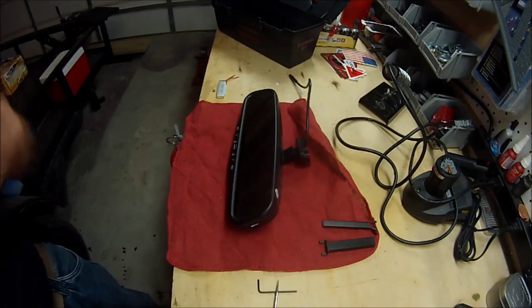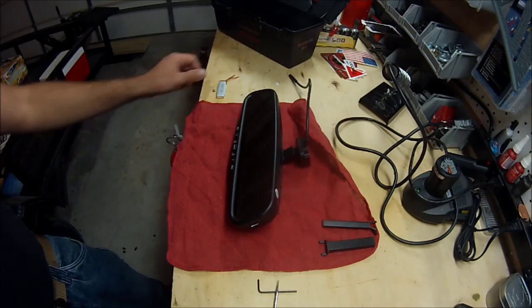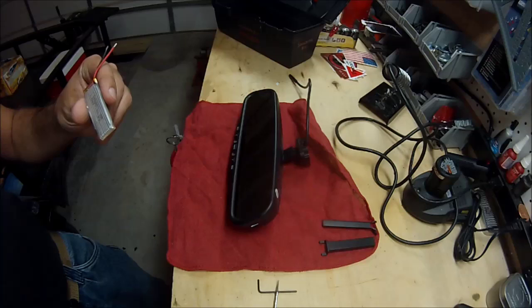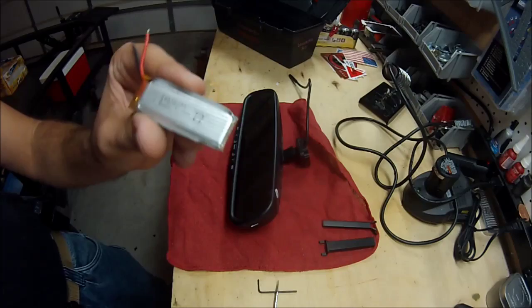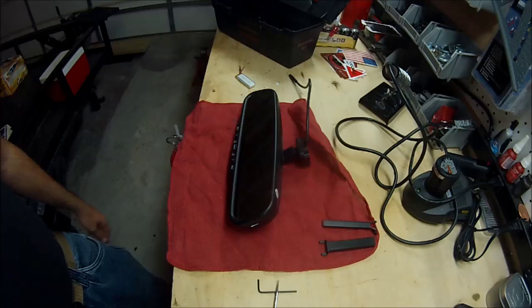This is going to be an update for the AutoVox DVR mirror. I got a battery to replace on the inside. It's a 3.7 volt, 450 milliamp, similar battery that goes in little remote control drones and stuff. I'll post the numbers and everything in the description of the video.